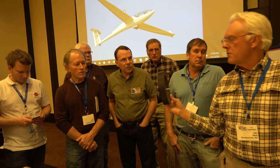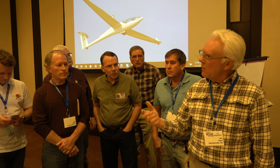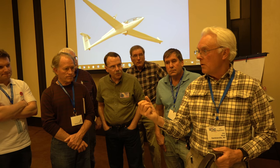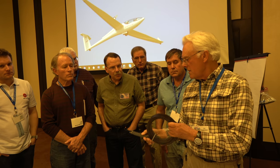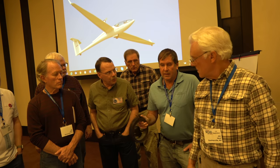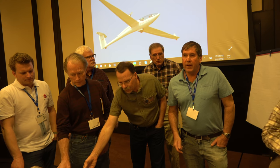This happened to me because I was trying to be clever. They take quite a while to start — you crank them maybe five or six seconds. Mine always starts but it always takes six seconds. I was trying to cut the seconds down and increase the prime, overdid it, and boom — broke straight away. When they break, you better have your hand on that throttle because otherwise it overspeeds and then you've really shot the engine. I would recommend leaning it or cutting the prime interval down. If you need more prime, push the button again — each time you push it, it'll prime. Better that than overprime and break the belt.